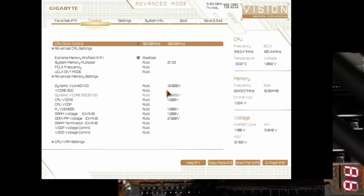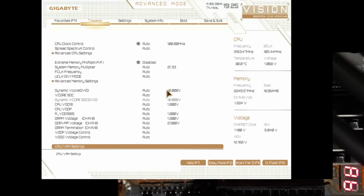So at this point, you might be thinking, okay, if you have boost enabled and you raise the BCLK, the boost algorithm just slows down. If you raise the BCLK more, the boost algorithm literally just turns itself off. If you bend over backwards and do a custom P state and everything that I had done at the start of the video, then you can technically get the CPU to run 4.2, almost 4.25 all core. But the whole system ends up being this weird, unstable mess where it sometimes doesn't want to reboot for reasons even I haven't figured out yet. So, what are your options?